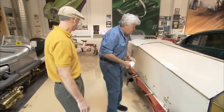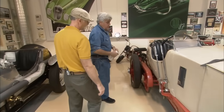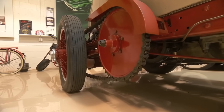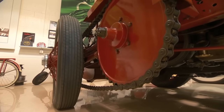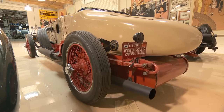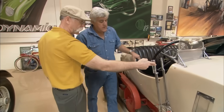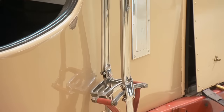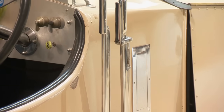This was a chain drive car — right here. That looks nice and safe; you don't want to drop your hand down. But this car ran at Brooklands and it runs right now. The only reason I'm not taking it out is because it literally has no brakes at all — just a transmission brake. We've got another axle and we're going to put brakes on it. There's one brake here, then a transmission brake that grabs the drive shaft — and when it catches fire, take your foot off the brake. The shifter is outside the car, which was quite common. The Hispano has it outside the car as well.